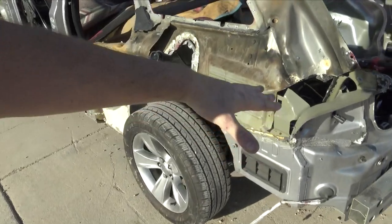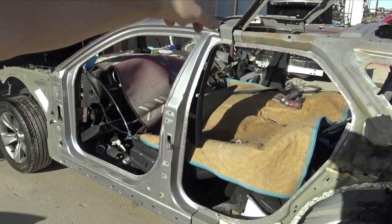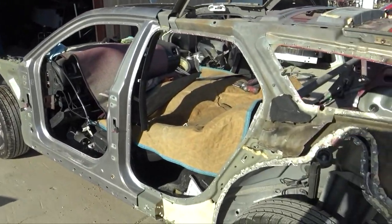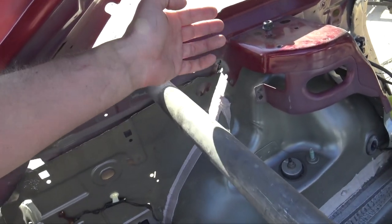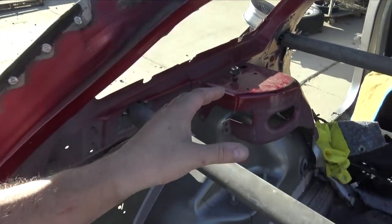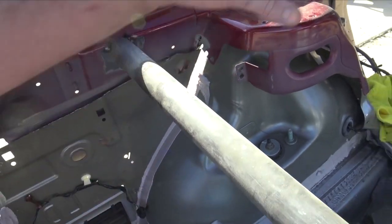It will bring the hatch down. You can see that it's off a little bit. It needs to just come down. That will line up, and then it needs to come forward a little bit. So I need to make sure everything butts up nice, so when I weld it, it's nice and tight. And then I used these, I left these from the Magnum. These are for the seat belts, but the reason I left them also was because they locate everything nice like factory. So these actually fit nice and tight, and these inner wheel wells are the same shape as the Magnum, so they'll come down.